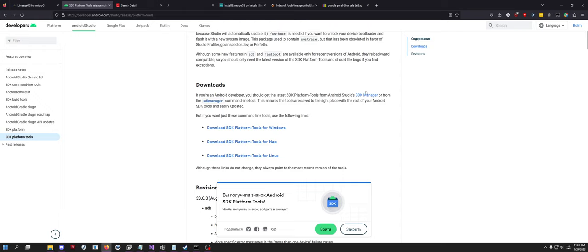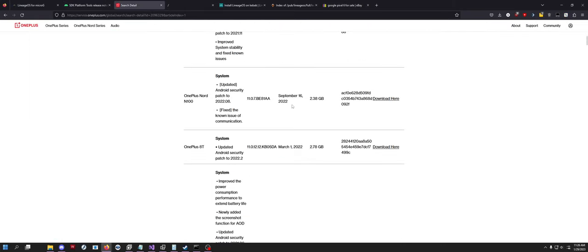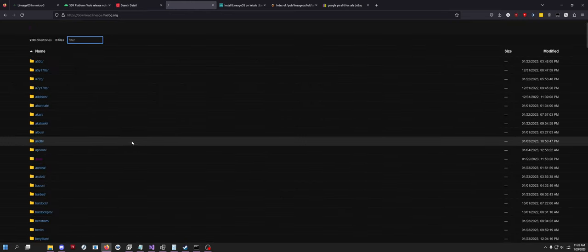So, once you have your platform tools and everything, you have the Android 13 update installed locally. You can also do a wireless update. You don't have to do this step. You can get it wirelessly from System Update once you're on Wi-Fi. Honestly, that's probably the easier method for most people. Make sure you have your USB cable plugged in, USB debugging, OEM unlock, both enabled.